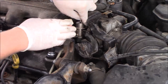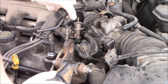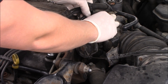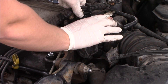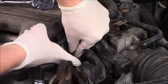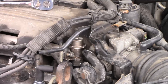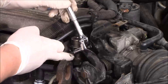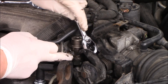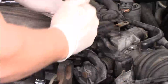You can see here the PCV valve — that's the black tube that's kind of bent and put into the crankcase. I took off that little 90-degree elbow and moved it out of the way just to make it a little easier. Attach your vacuum tube to the top of the regulator; the vacuum pulls a diaphragm valve inside the regulator and allows fuel to go into the fuel rail. Next, put your screw back in to attach the regulator to the fuel rail. As I said in the beginning, it's probably best to take off the throttle body to make this job a little bit easier — but as they say, hindsight is 20/20.